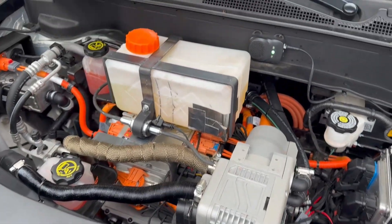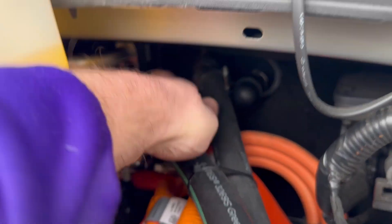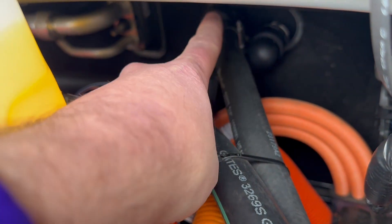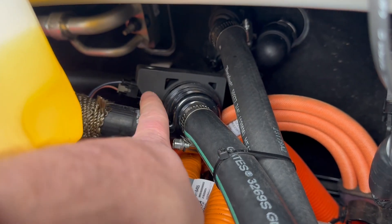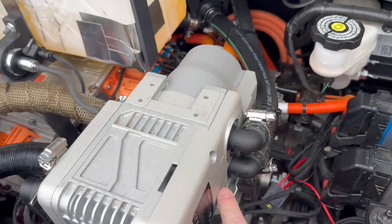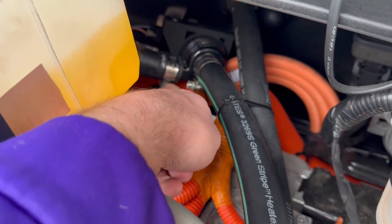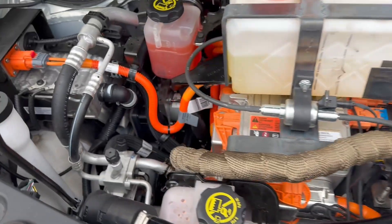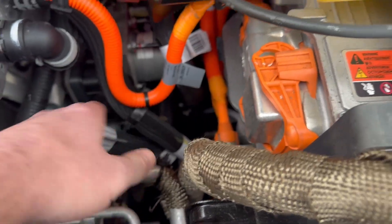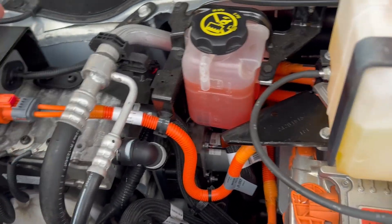It was $300. I plumbed it into the factory coolant line — this is the factory line that went right here, into there. We took that off and put my intake for my diesel heater where it was. The outtake goes to a water pump that you have to have for this model, and it pumps the water down to the factory pump somewhere down there. Then it comes back up here into the factory heater box and into the car.